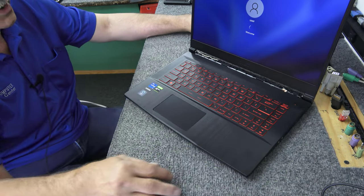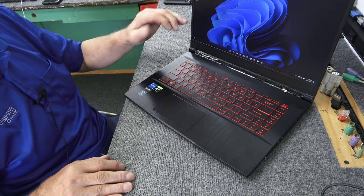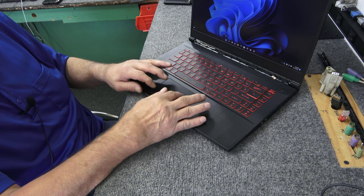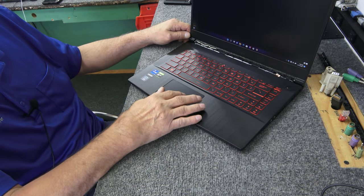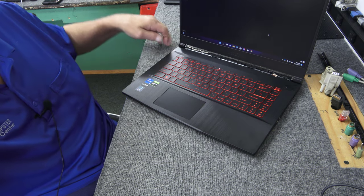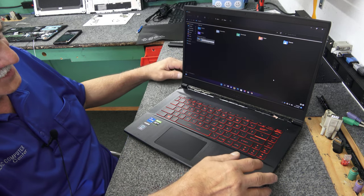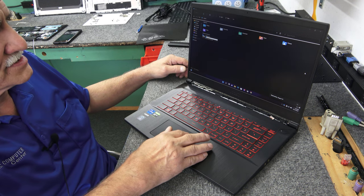We got a POST. There's our Data Migration software. When you're all said and done you can uninstall that. There was a little warning that popped up saying low SSD space — not sure what that was about, but it's gone now. We still have the one-terabyte SATA SSD we need to initialize. I'm going to right-click on the Start button and go to Disk Management.